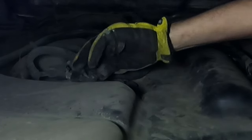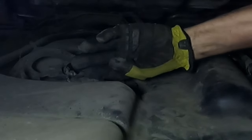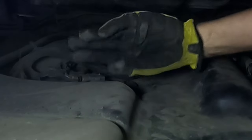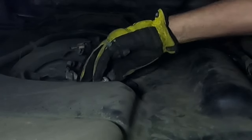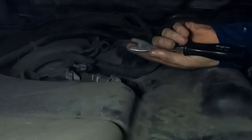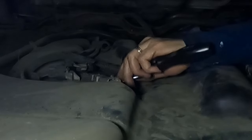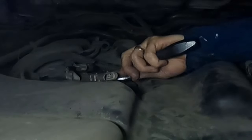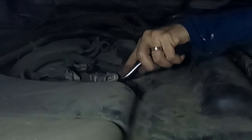I've got my hand on the electrical connector — I should be able to pry up on the latch and just pop that off. Now the tank pressure sensor is free. I'm going to wiggle it around to get it ready to be popped out. I'll grab this spudger tool and use it to get underneath the body of the sensor and pop it out. I'll just gently pry up on this and hope it comes out in one piece.